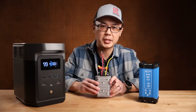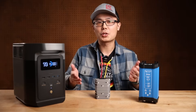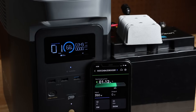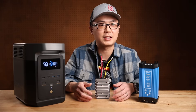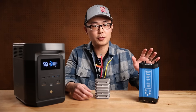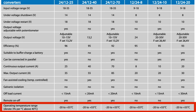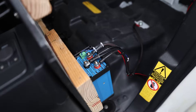What about dirt-cheap Amazon special converters? They are more compact, shock-proof, and waterproof. Aren't they just the better options for 4x4 off-roaders? That's what I thought, so I actually started with one — a 12-24V converter with a 20A rated current. I got 350W charging power, which is still pretty good. But the issue is the warm and fuzziness of the specification. A name-brand like Victron Energy gives you a definitive spec sheet — the 20A current rating means continuous current, with a separate max instantaneous current. The operating temperature refers to the environment, not the device itself. So as long as the interior of my FJ stays below 55°C, I can always count on it.